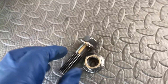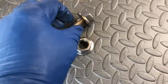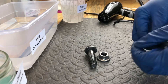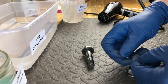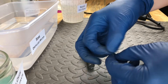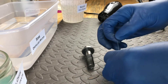The first thing I'm going to do is spray these with some Super Clean degreaser and just make sure they're clean with no oil or grease on them. I've been wearing my gloves the whole time, but you never know with stuff around the garage. I'm going to go ahead and string these up on some fishing line, just so they're easier to handle going in and out of the black oxide and the sealer. With the dry finish sealer I'm using, it's best not to handle it after you dip it.